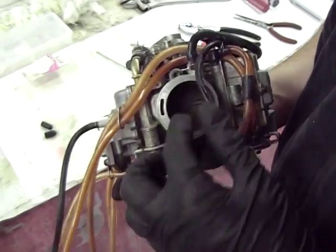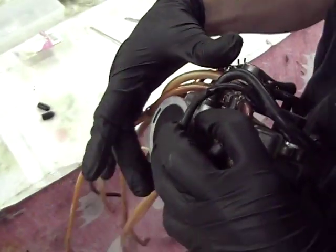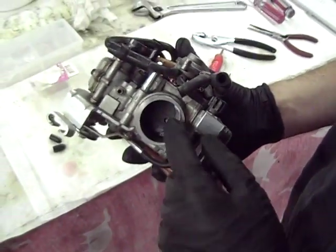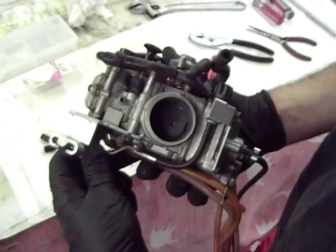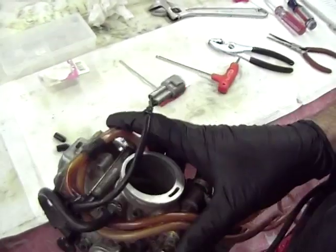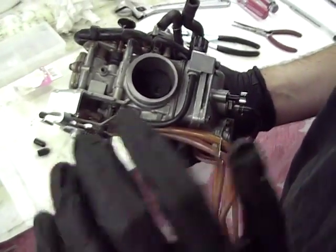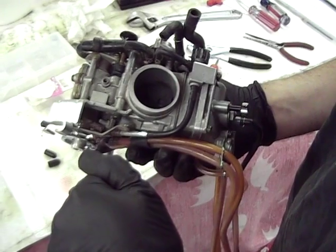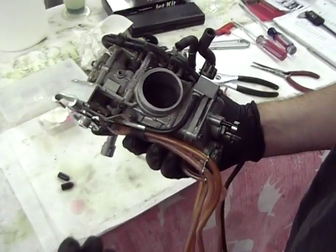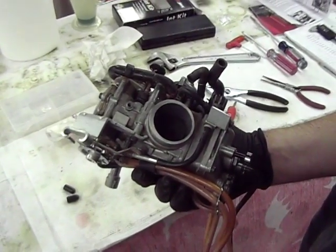Now, the other thing that I wanted to mention here is that people say, well, gosh, I'd really love to have a fuel-injected bike over a carbureted bike. And there may be some value to that, but there are some things about these carburetors that are really nice. And that is when you decelerate, the way these slides are designed, and this one not so much as the diaphragm slides are, when you cut the throttle, you get a little bit of airflow that still comes through there that actually smooths that out and makes the engine braking not quite as radical.